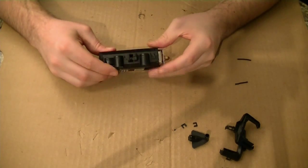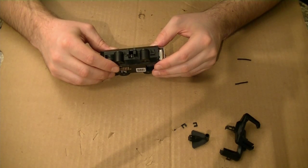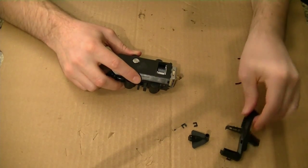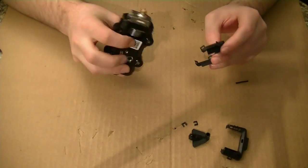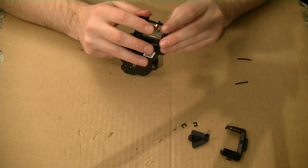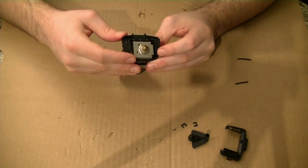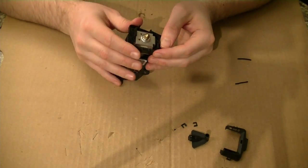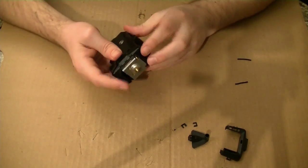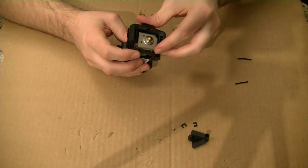Once you've finally got the case, put it back together — it can take a long time so be patient and just keep working on it, you'll get it eventually. Snap your pieces back on, starting with the bottom piece right by the nozzle. There are two pieces that come off — snap those back on. The one with the four clips goes on first, then put on the second top piece, the one with two clips.